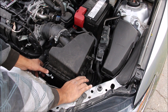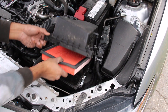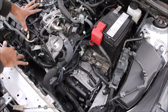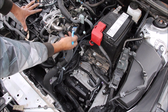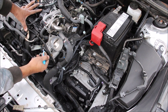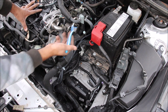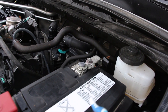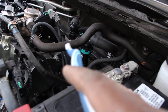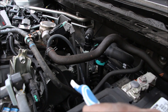The air filter on the new Camry is pretty easy to access — no tools needed, just two clips. You pick up the air box and remove the filter. With the air intake system removed you can see a lot of room to work, with a closer look at the EGR cooler, the drive-by-wire throttle body, the lower radiator hose going into the engine, and the transmission below. Behind the battery you have the brake booster and master cylinder, driven off a vacuum pump located inside, which is driven off the exhaust camshaft.